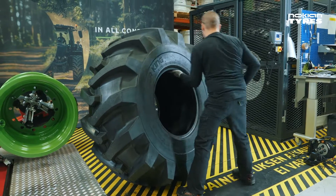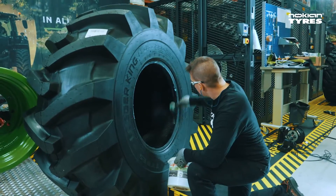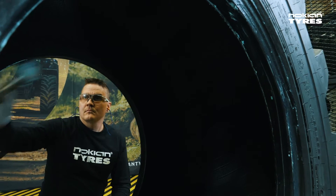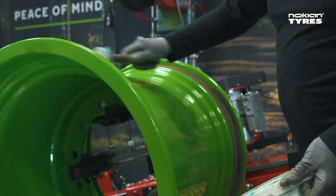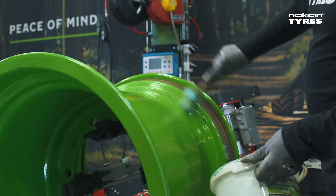At this point you should decide whether the tyre is meant for the right or left side of the vehicle. Apply some grease to the outer side bead area of the tyre. Apply some grease to the inside of the tyre and inside bead that goes towards the assembly machine. Grease properly inside the rim as well as both rim flanges and bead area. This allows the tyre to easily slide over the flange to the mounting groove.